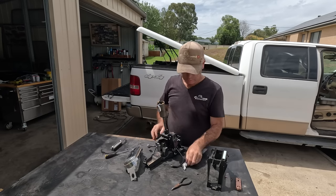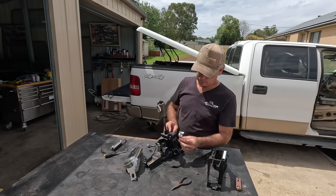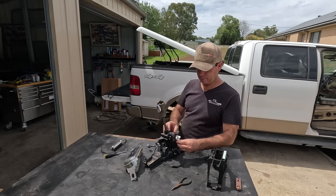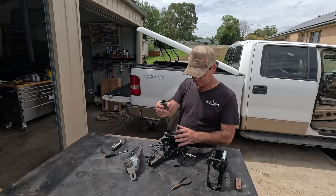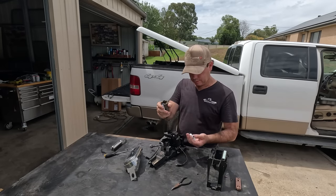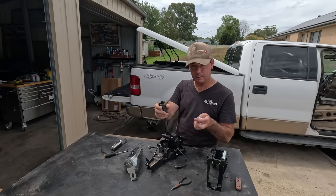It works fine. I would say that little safety bit that was in there, that now isn't, wasn't being activated. I think that's the bit that depresses when you put your foot on the brake. It depresses, but it wasn't depressing. That's why it was locked up. And I'd say that's how it started. Maybe somebody's pulled on it too hard, damaged the cable, I don't know.